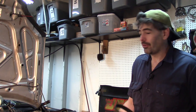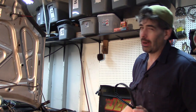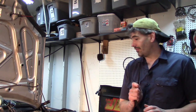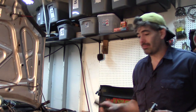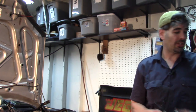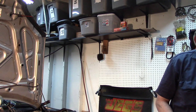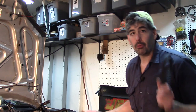Howdy guys, I'm going to try to help you out if you're in the midst of a timing belt change on a VTEC engine and you get yourself into a little trouble, because it's not quite as intuitive as you would think. I've got my timing belt here that I'm going to put on. Anytime you do a timing belt change, as in my previous video on a Toyota, I always recommend replacing your water pump, pulleys, tensioners, and things like that. This one uses a tensioner spring as well, so all of those have been replaced and I'm now ready to put it back together.